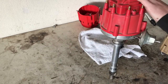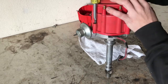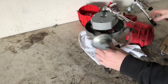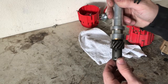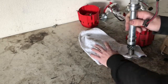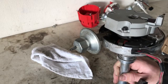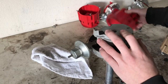To remove the cap, there are just four screws — take a flathead screwdriver, push down real hard on them and turn it out to the side, and the cap should just come right off. As you can see, this gear at the bottom of the distributor meshes in with the cam gear, so when your cam spins it rotates your distributor. As the motor is cranking or the car is running, your camshaft is always spinning, so it's always spinning your distributor cap. When this top piece is spinning, there's a little tab that spins inside of your distributor cap.